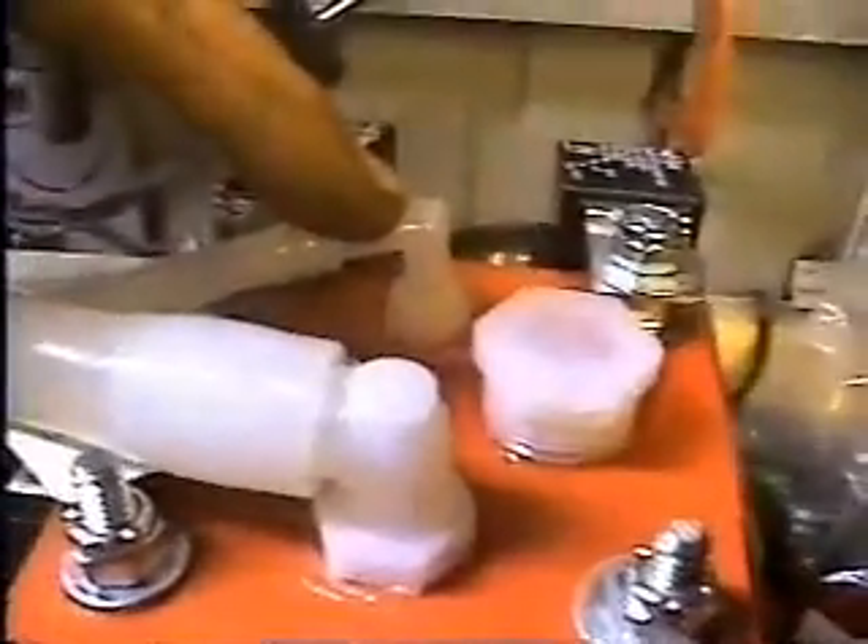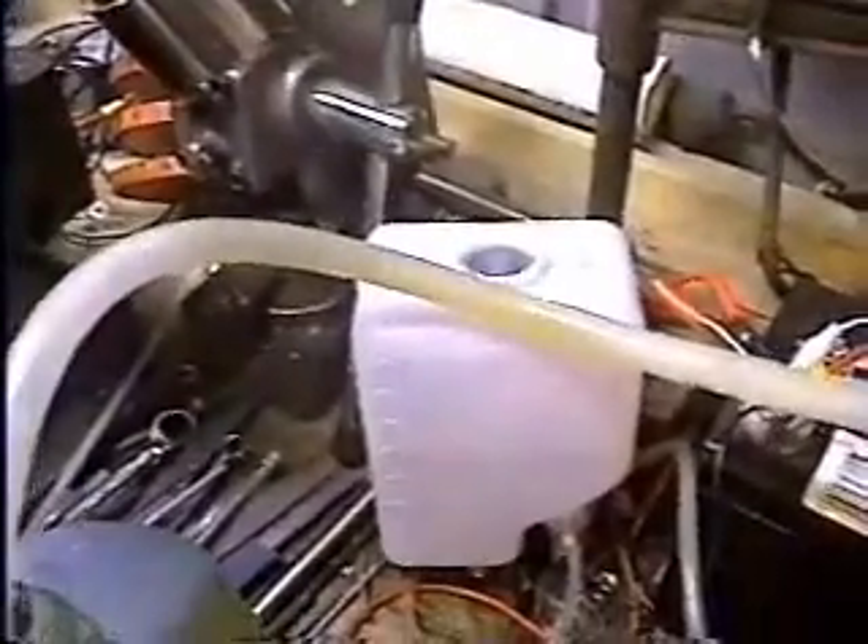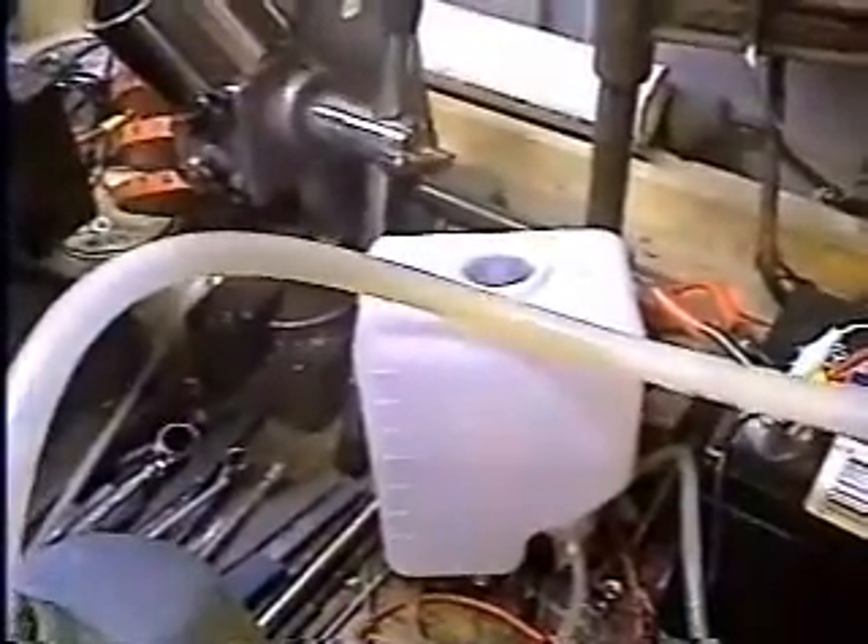Getting up close, you can see the top of it. I'll point out a few things. Over here is the autofill. This is the fill-in viewport. This line right here is the hydrogen outbound. And directly over it, there's the fluid sensor level switch, which is located right down there. That tells the pump and the reserve tank when to put water in. There's some condensate in the line to show you that there is gas going through the line.